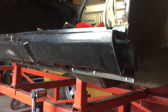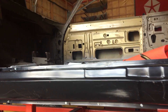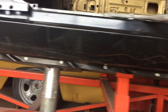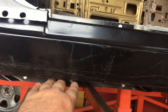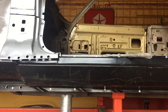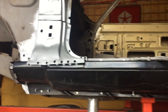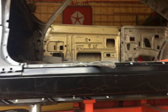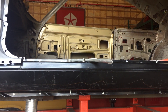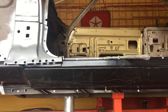That includes this rocker panel. A lot of people don't replace rocker panels — they'll patch them. Back when I first built this car in the early 1990s it had typical rust around the cross member underneath. I patched it up, never even drove the car, and it was already rusting through the patches — good quality patches too. It seems that if you upset the metal by welding, it actually induces corrosion.